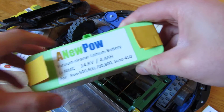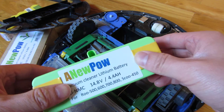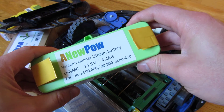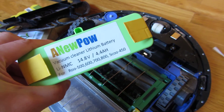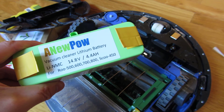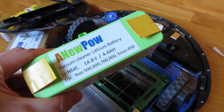The light will change color — this is stated in the instruction manuals and it is true. Even with my other Roomba and other lithium battery, it starts out green — the battery indicator light on top of the Roomba. After about two hours it'll turn orange. Don't be concerned because that still means there's two more hours, or maybe one and a half hours left. And even when it turns red, it will still probably have an hour and a half or an hour left. For me, the docking light started blinking probably three hours and 45 minutes into the battery, based on the stopwatch I was using.